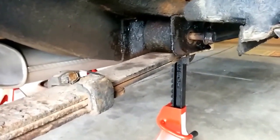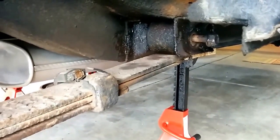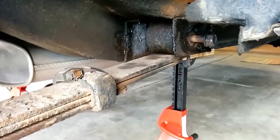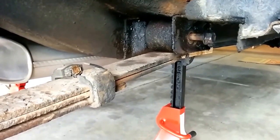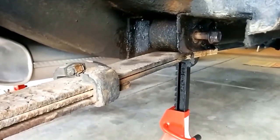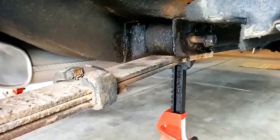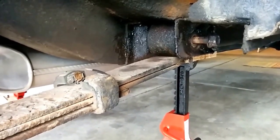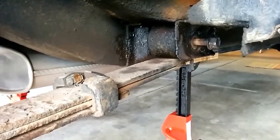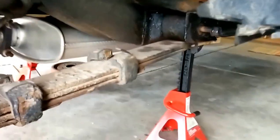This one was about the same. Instead of trying to start it with the impact wrench, I went ahead and just started with the breaker with the cheater. You basically heat up that bolt real hot so it loosens up the Loctite a little bit. At first if you make just a tiny bit of progress, use it — don't try to squander it. Just use that little bit of progress, move the breaker, get a little more. As you go it just gets easier and easier. Then towards the end I did pull out the impact wrench to run it the rest of the way out, because it's pretty slow going with the breaker bar. Tried to put a normal socket wrench on it and just didn't have the leverage to keep it moving, so the impact wrench took it out.